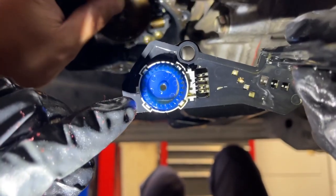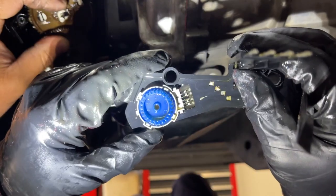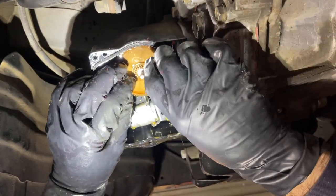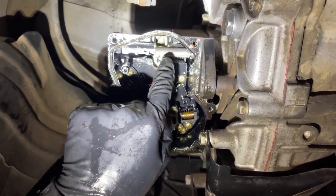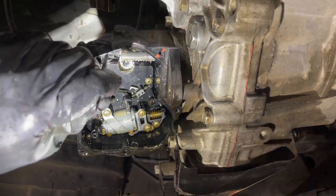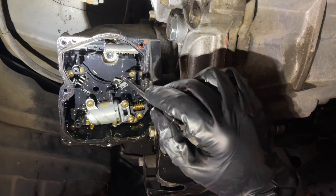I got a good idea of it. It's interesting — it's not where I thought it would be, but that tells us something. I'm going to carefully put this aside so I don't accidentally turn the dial. I'm looking at the blue dial which has a tiny little mark on it and seeing where that mark lines up with the white case around it. Currently it's lined up right there. I'll take over for Viet, slide this gear off, and pull this other one out. The position of the shaft right now is clearly unlocked — I can turn the drive shaft. When it is locked, the shaft comes out more and further into the case. Here's the switch I think might be bad, compromised with all this gear oil going through it.